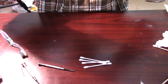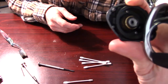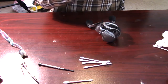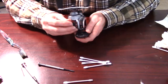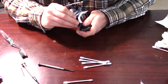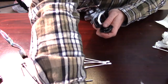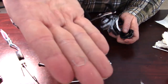The q-tip goes all the way in - twist it and then pull it out. Do that a couple times and you're going to find a lot of grime comes out of there. Now you've got that ball bearing there with a little wire that holds the ball bearing in. This is really tricky - you want to take a small fine screwdriver, but be very careful because these tend to snap. Put your finger over top of it to keep it from snapping, then pull it out.